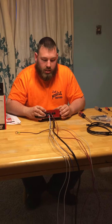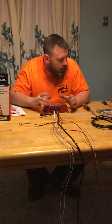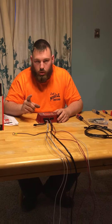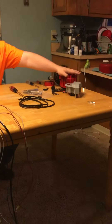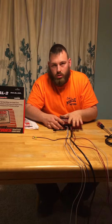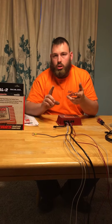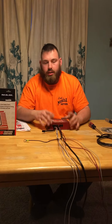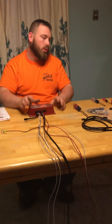It also sparks multiple times per rotation in the cylinder. So instead of one spark from your stock HEI system, you're now getting multiple sparks up to 3,000 RPM. That means better cold starts, hot starts, better fuel consumption, and more horsepower. Some people report 20 horsepower added just by adding one of these boxes because it's that much more efficient at burning fuel.